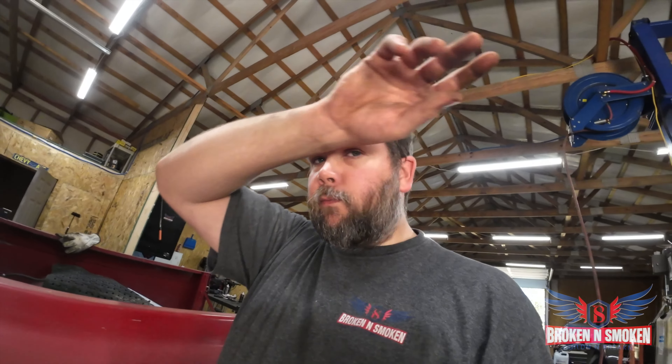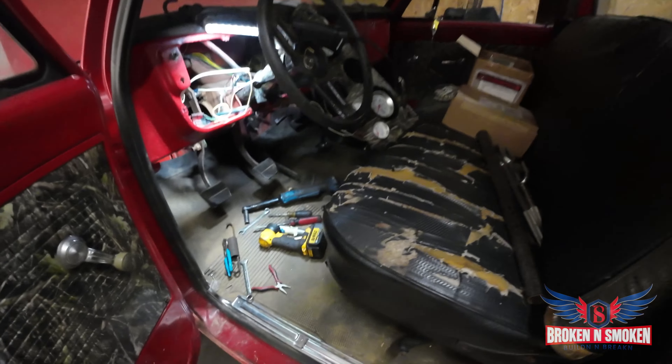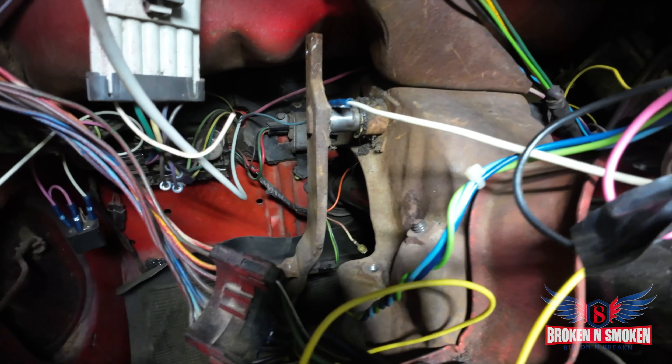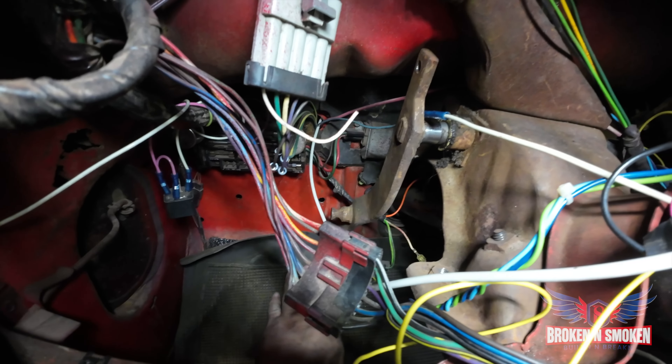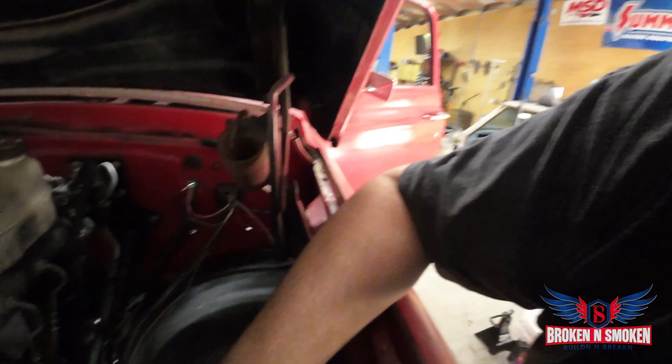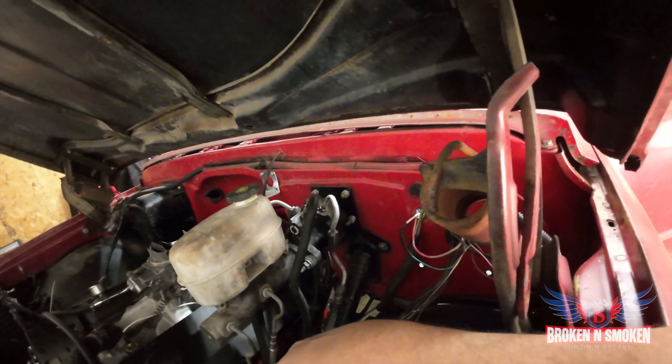Well, I done drew up a little sweat here. Never mind my wiring — I ain't come back and zip-tied nothing, but I got it all disconnected. Going to slide this out, but you can't because it hits over here. Get it moved up, it hits under the cowl part under here. So what's that mean? It means I'm going to have to drop the steering column, drop the hydro boost — there's four bolts right here — and pull it away from the firewall. So I guess I'm going to reassemble the one we had over on our mock-up stand and just swap out the assemblies.